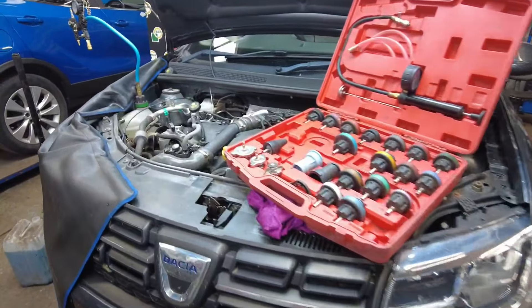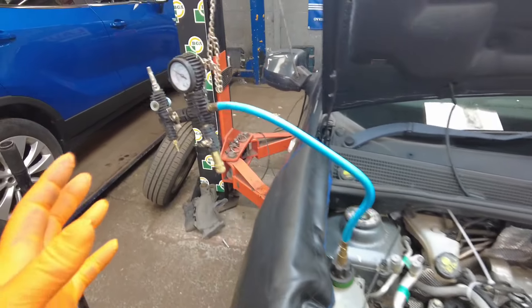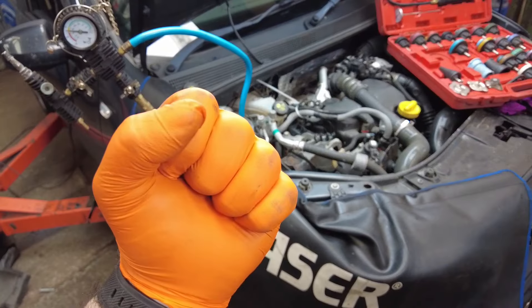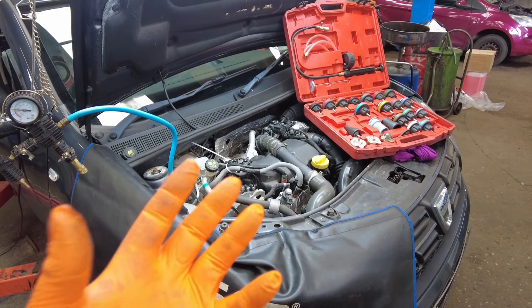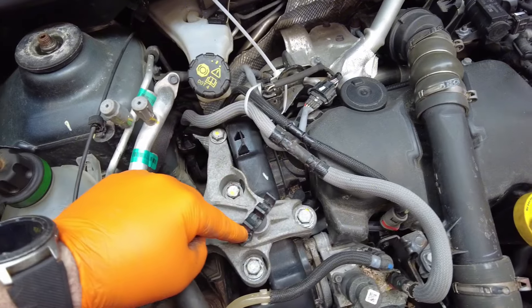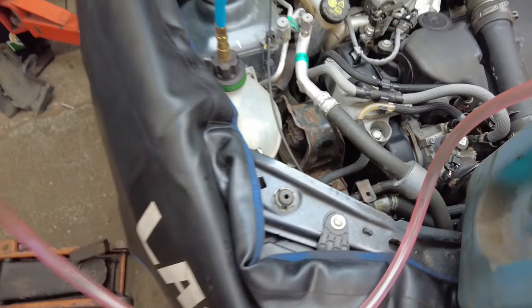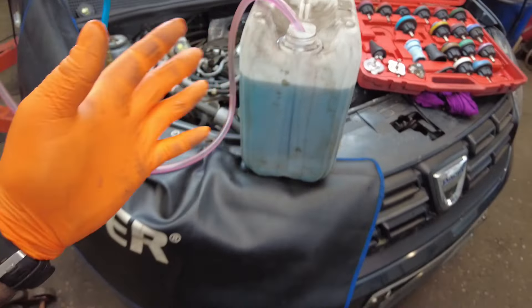Let's drop it down now and put the rest of these covers back on. We've got all the covers back on, the engine is bolted back to the chassis. We're going to go ahead and refill the cooling system — we're going to be using a coolant vacuum and refill tool. If you haven't got one of these and haven't used one, you need to buy one — they're not much, about 80 to 90 quid off Amazon. What it does is pull all the air out of the system; you leave it for about five minutes, make sure you've got no leaks, then fill the coolant in and it won't have any air in it. Brilliant — game changer.